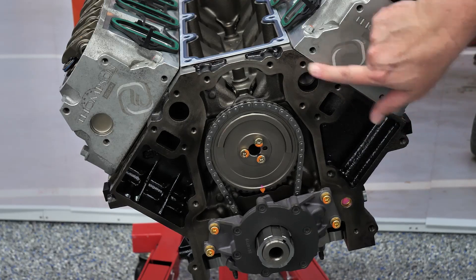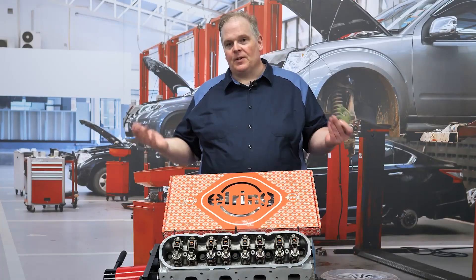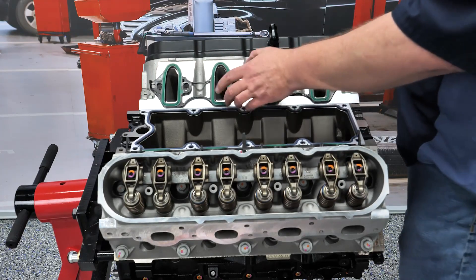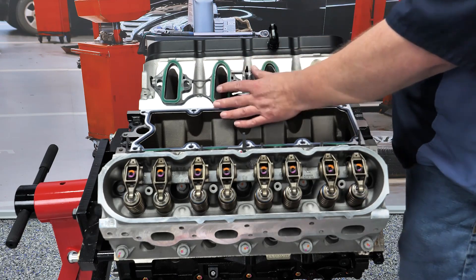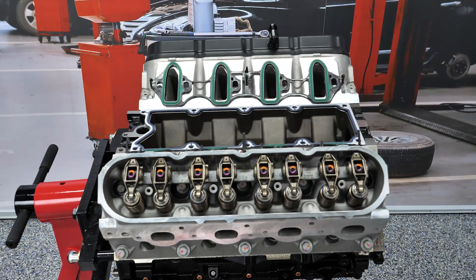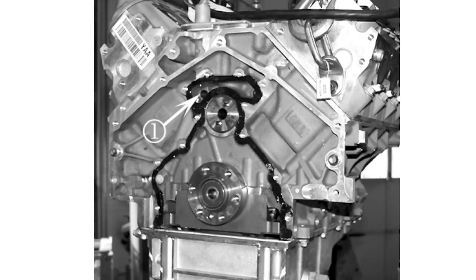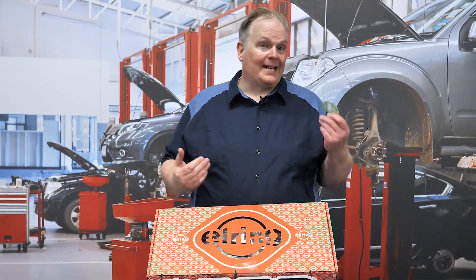You need to look for these. If you see one, there are a couple of options. Sometimes you can get away with just RTV over those pores to help the gasket seal. In some cases, you might want to send it back to the machine shop, but you're always running the risk of exposing more pores and more voids. The most important thing to do is do not go after this with an abrasive disc to eliminate those pores — chances are you're going to get an uneven surface, and it's going to make it even harder for a gasket to seal.